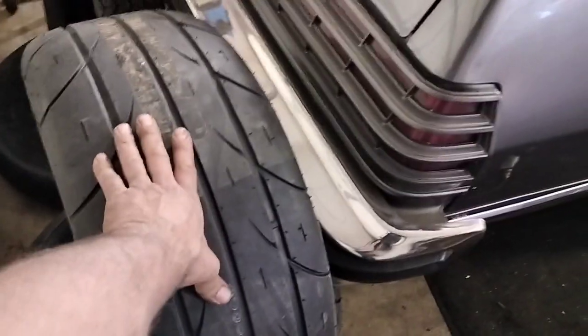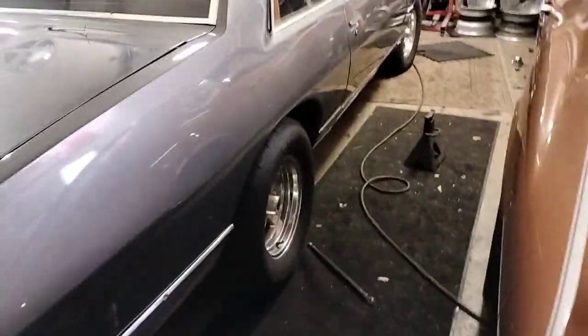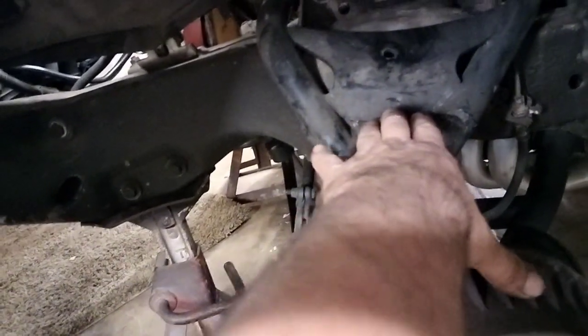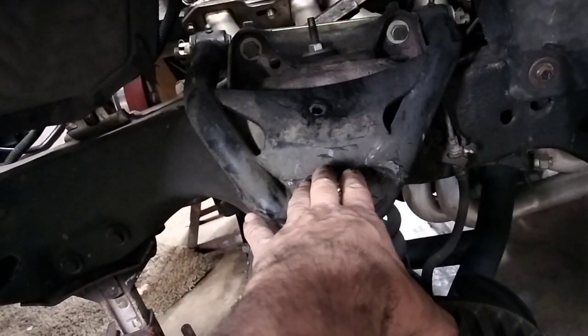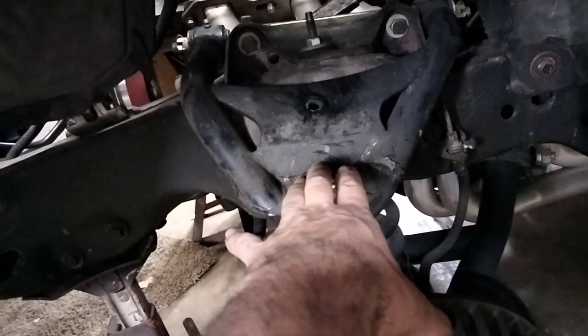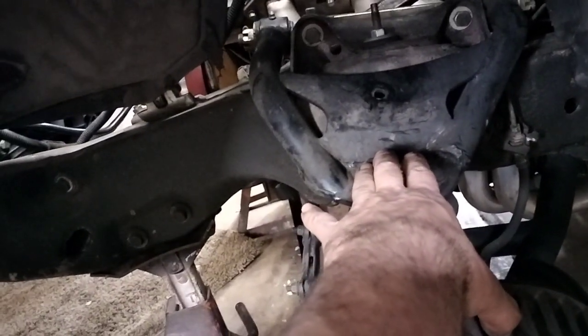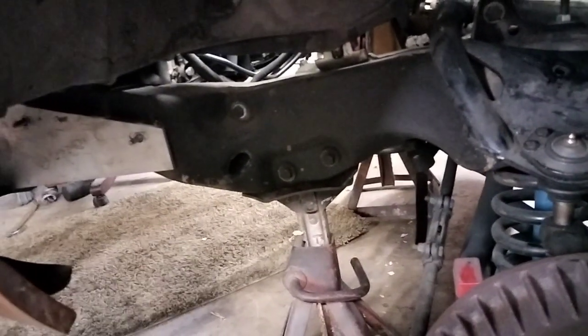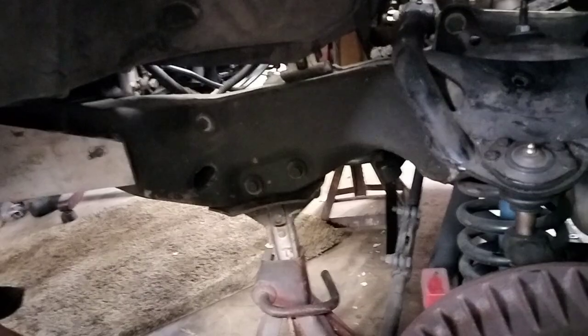You know, nothing crazy, but we got new tires on the same old wheels. Hoping to make some good runs on the radials because the radials are always faster. But we had traction issues all weekend. But after talking to you guys, and again, I'm being totally open with you guys, the hardware for our limiter was sitting here. So what that means is that the right side is topping out on travel before the left side does. The car is very unsquare. That would definitely unload it. And that could have a lot to do with why we were having the problems we were having.